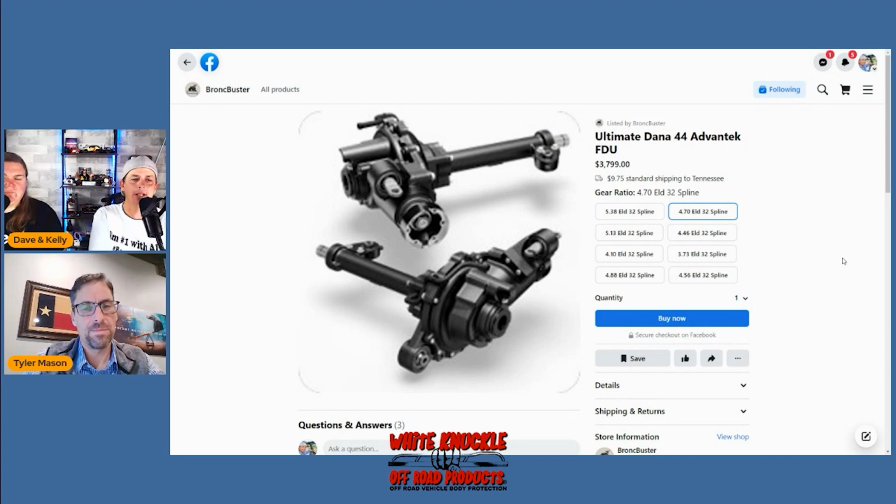And the price of it, I was surprised. It's not out of line, there's a lot to that for sure. That outboard shaft is cast steel instead of cast aluminum. And of course 32 spline, so it's a lot bigger diameter, chromoly, being able to gear to different ratios. The biggest holdup has been all of the programming from Ford, getting that to coordinate, and still working through some stuff on the early release, because once you re-gear, your wheel speed sensors and your driveline sensors are not going to correlate properly, and you're going to get faults, and the computer's going to think something's wrong and put you in limp mode. So that's been the biggest holdup in this.